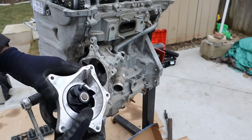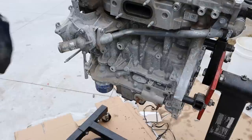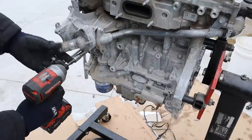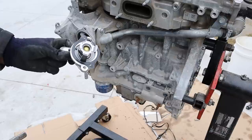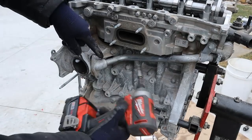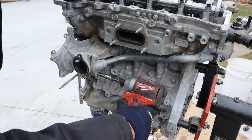Here's what the water pump looks like. This impeller is unfortunately made of plastic. Next up we're going to remove the thermostat housing on the back of the water pump. Here's the thermostat, and the housing is made of metal which I like. We're going to remove these two lines that go to a crossover tube to the other side of the engine.